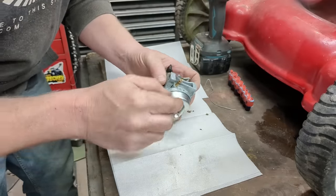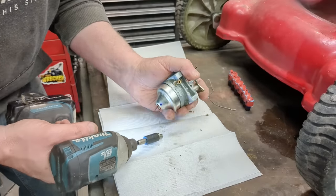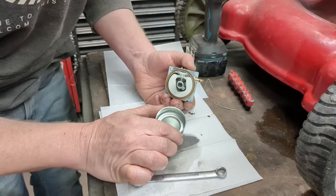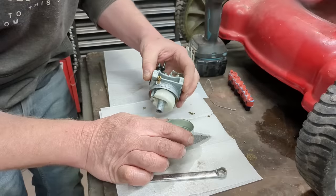All we need to do is clean the passage from here, through here, and up to there — really simple. We'll take off the bowl of the carburetor. Let's look inside. I'm assuming this carburetor is going to be pretty clean. Yeah — the carburetor is spotless. So people will look in there and say 'my carburetor is spotless, why is it doing this?'